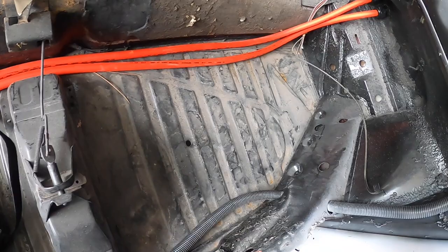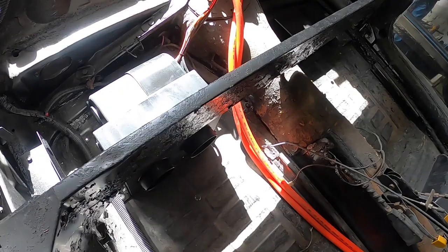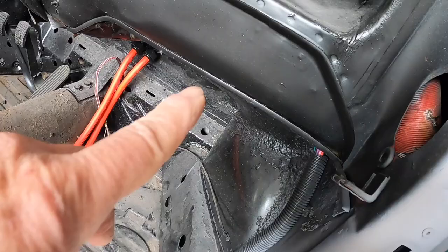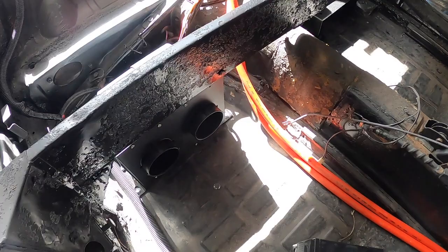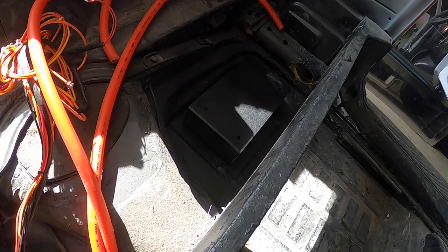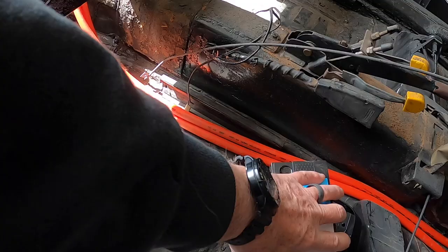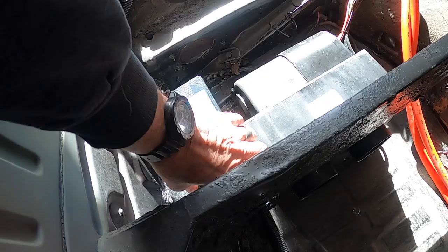I have a shorter wire run now. I got the heater mounted behind the seat — my plan was originally to put it up in that area but it would have hung down too far and wouldn't look right. So I mounted it right under the rear seat, nice and solid. I also fabricated some metal brackets and a platform for the contactor box and control boxes to sit right on top — fabricated that, bent it up, and welded it to the floor. The battery goes right in between the heater with a velcro strap to hold it in nice and neat.